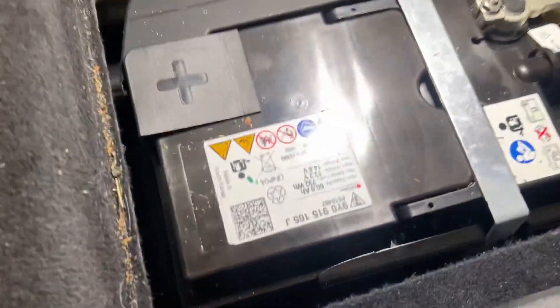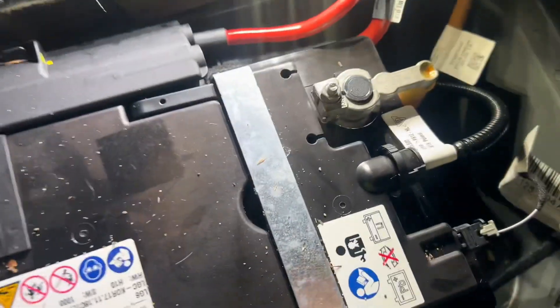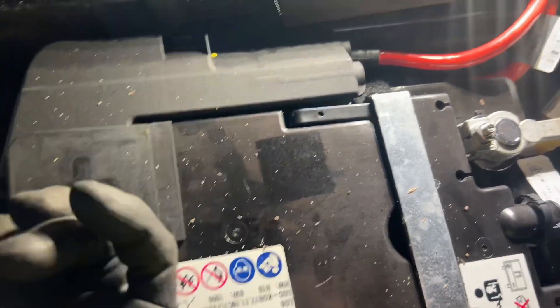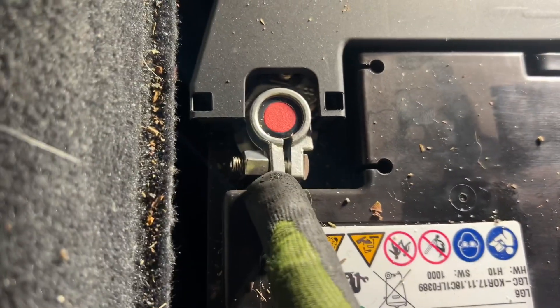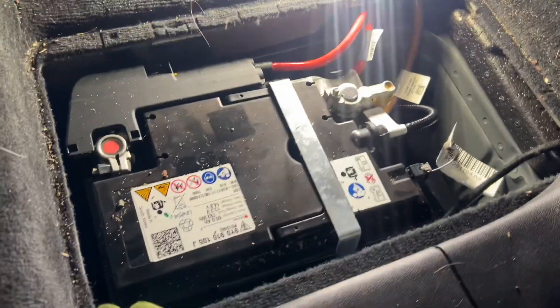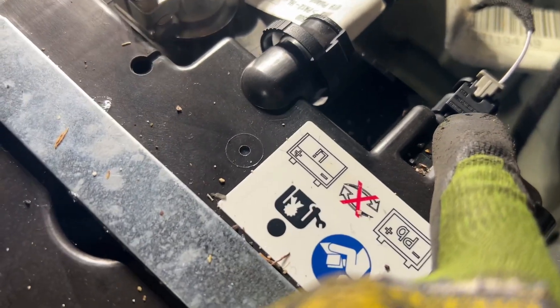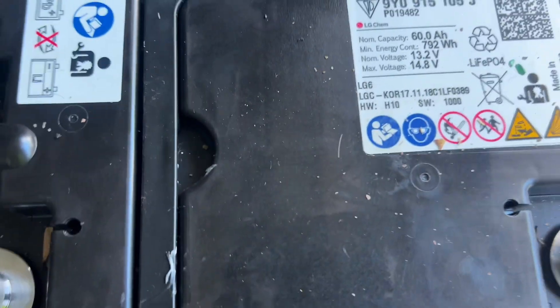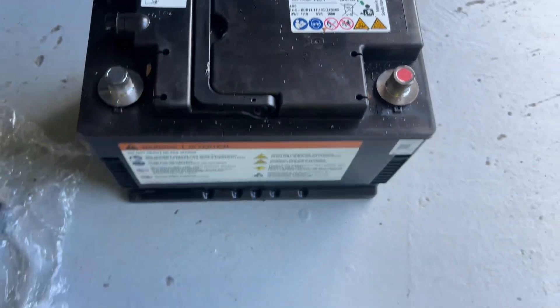Looking at the battery, you've got a 10mm here for the negative terminal, and then a 10mm here, and then inside here we've got the 13mm with an extension. Just got to take that out — that's the battery bracket holder. Then remove this battery. We have a sensor plug here, which we will take out, and also a battery discharge tube.